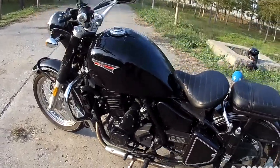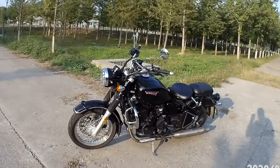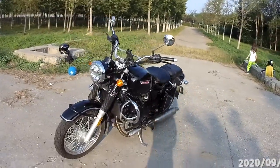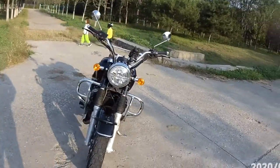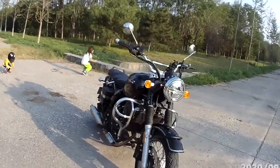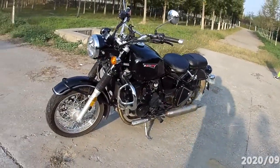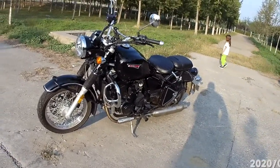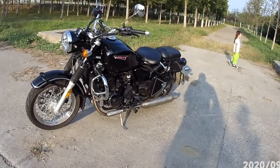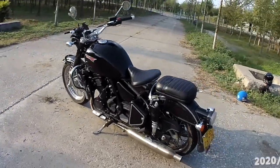What's the bike like? It's a nice looking bike and it's very good in a straight line. One of the problems with the bike in the solo version is this bike was really designed to have a sidecar on it. So the bike's not really designed to lean. Because when you do lean this bike into corners, the exhaust touches the ground. I've been riding in the mountains here in Beijing, taking corners with friends on cruisers and sports bikes, but I just found that in sharp corners my bike kept touching the mufflers on the road. So that's not a good thing, but I guess I just need to take it a little bit easier when I ride.